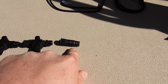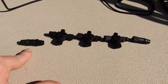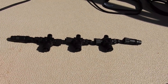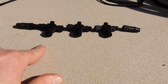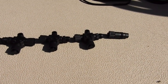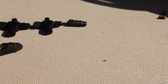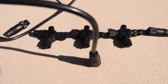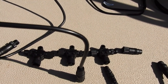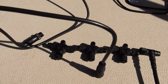Very importantly, you have two end nodes that basically stop the backbone. We're going to start the system at one end, put an end node there to stop the backbone, then run the power supply cable in. The Yamaha cable input goes into the center T. On the third one I'm going to hook up the cable to the Garmin GPS chart plotter, and then put the other terminating cap on. So that's the plan — let's put it together.